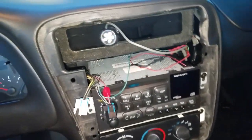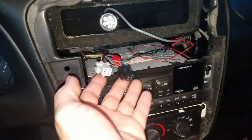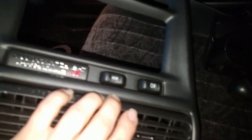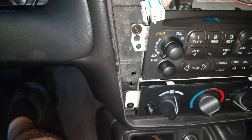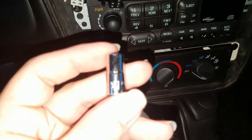Remove this bezel right here for the radio, air conditioner, and the air-conditioning controls. You have to do these two harnesses when the bezel is in there for these two switches. Some cars might have one, but this car has two — one for the fog light and one for the ASR. You're gonna unclip it from the back by pressing in on these sides here, just push into them and then just pull right out. Do it carefully though.